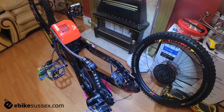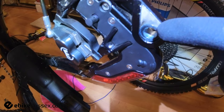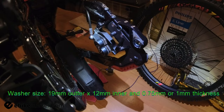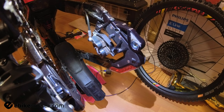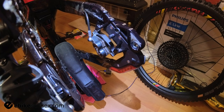To get that 1mm gap, I came up with a little idea. See this washer — it fits in, and there's already one in there. This one is slightly thinner. Look for something less than a millimeter — the thinner the better — so the bike's wheel axle can still rest on the lip. By pressing and tightening the wheel back into place, the speed sensor is no longer catching. That's why I now have a perfect install.